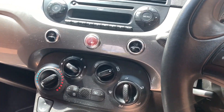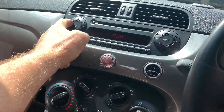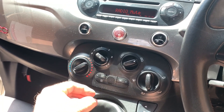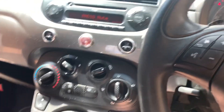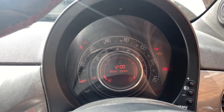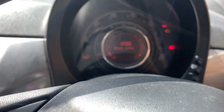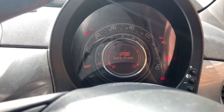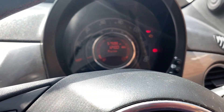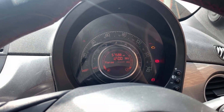In theory, turn the ignition on. Turn the volume down - it might have to fire up. In theory it should give us a flashing mileage. I've got the doors open, so that doesn't help. It's not coming up with the mileage. If I press the star - no, it's not. So to me, that means it's probably not going to work, maybe those fuses have gone.